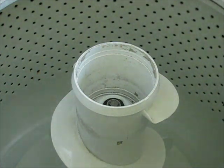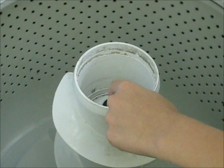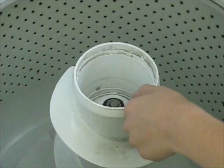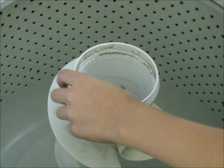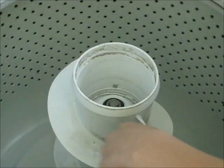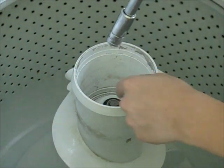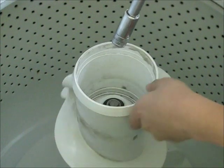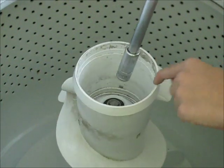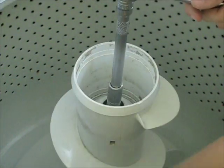As you can see, those dogs are supposed to have teeth in there in order for them to grab the agitator assembly and move with the bottom agitator as it rotates back and forth 90 degrees. The teeth are very, very worn off of that, so it's not doing anything.